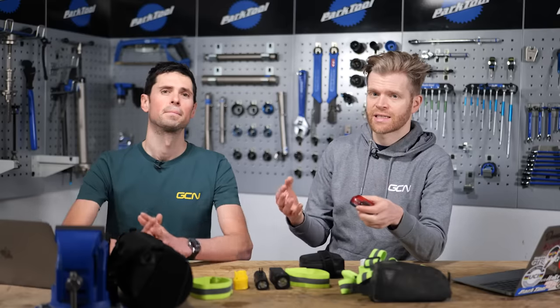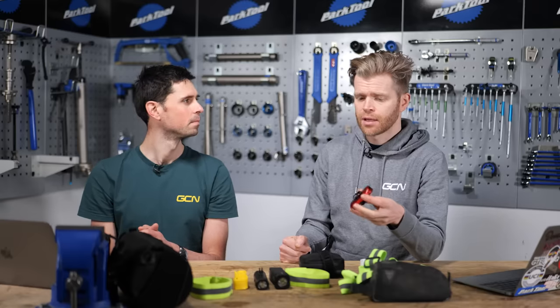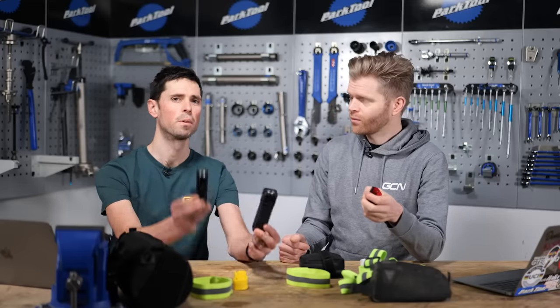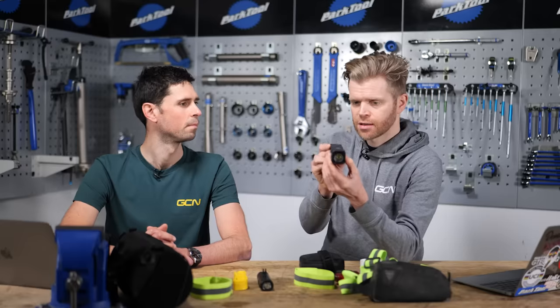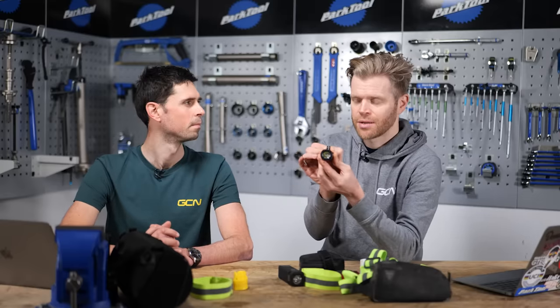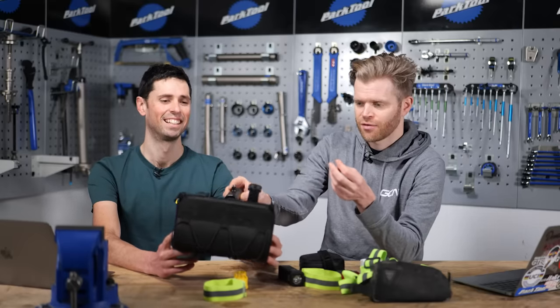From experience descending in the Alps in pitch black in the middle of the night, I would say you're going to want at least 1,000 lumens on the front, because the speeds are greater and you're hitting hairpin bends where it's not always obvious where the road is going. Look at the size difference between a 1,200-lumen and an 800-lumen light. Always have a backup light as well. Also, a lot of lights now have an underslung option — the mounting goes into a GoPro mount, typically underneath where your bike computer goes. Just be aware this can sometimes be an issue if you've got a bar bag on, as sometimes you can't fit the light underneath.